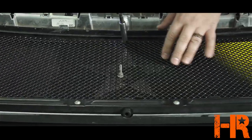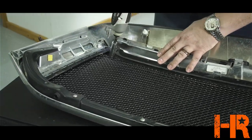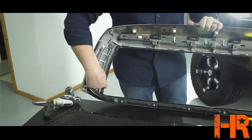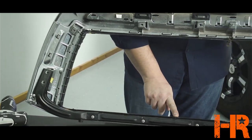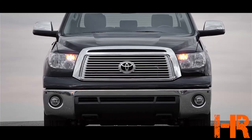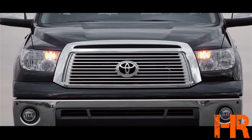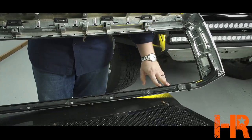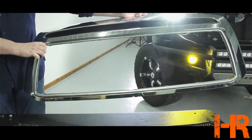Once we have all the mounts released, the steel grill and the plastic original grill should just let go of each other. Here you can actually see what was cut on the Tundra grill, and this is going to be a really similar application whether it's a Tundra, a Ford, a Chevy, or a Dodge — these vertical bars here were chopped off and trimmed, and all the extra pieces that stuck up in the center were trimmed. The stock grill used to have plastic bars going left and right. Some people could use a small sawzall, an air saw, or even a Dremel if you've got the patience, and now you can see the front of the grill ready for the new Royalty Core grill to be installed.